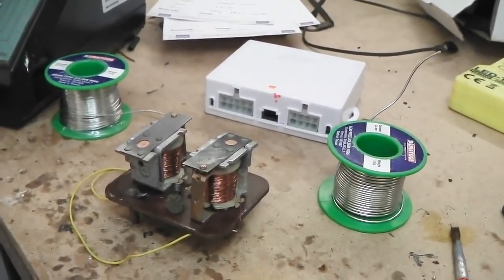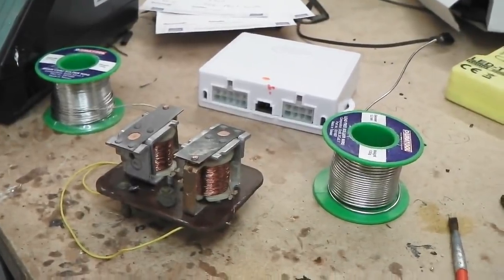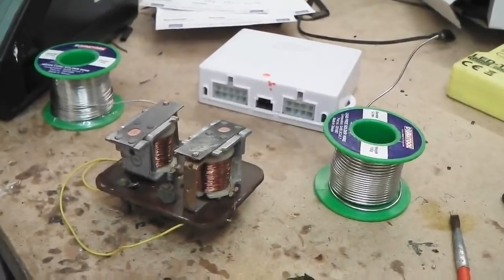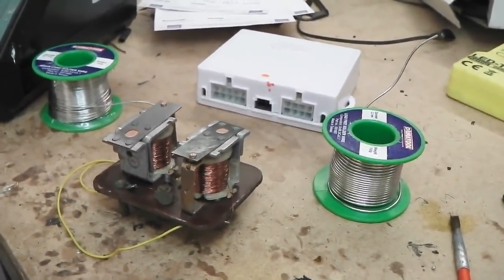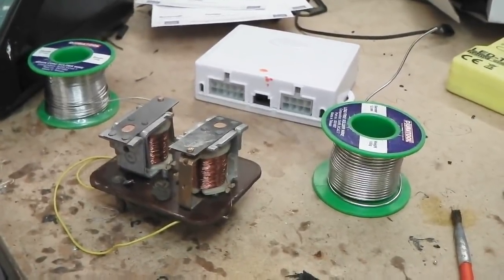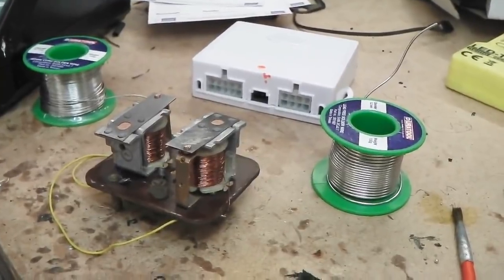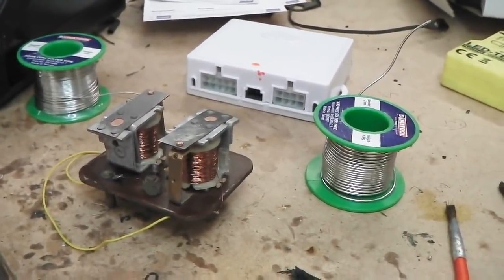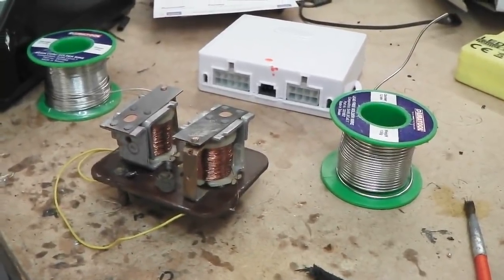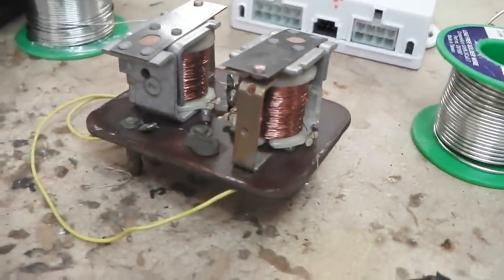That then feeds to the switch and enables power to this indicator stalk, which then becomes a parking light system. So it swaps from indicator to being parking light. So indicate down, left hand side, park lights come on; push up, indicate right, right hand side parking lights come on. To do that, you only want that working when the key is out. Therefore, when you turn the key off, there's a positive feed supplied, via the stalk, to the headlamp relay. I think it goes through the headlamp relay, it has to actually, and then off it goes.